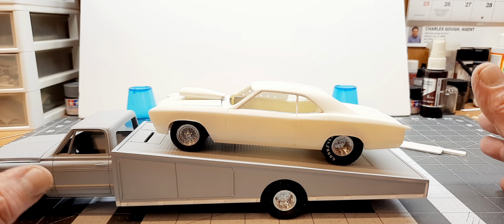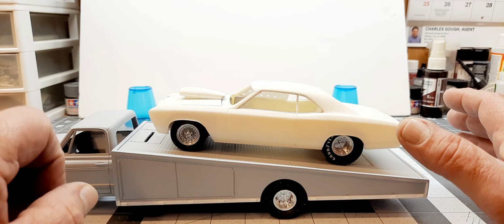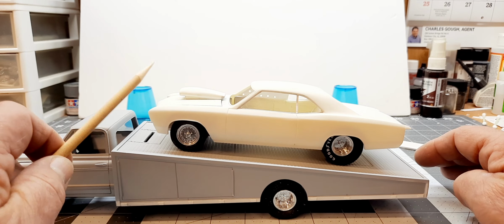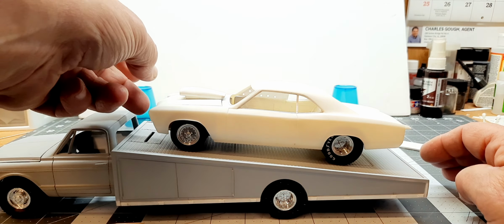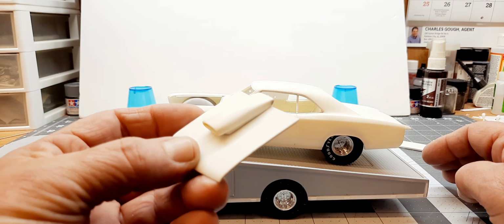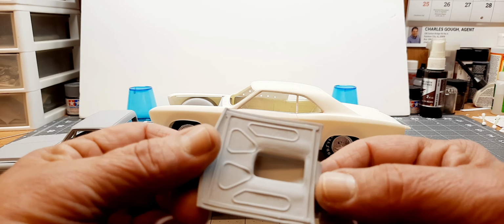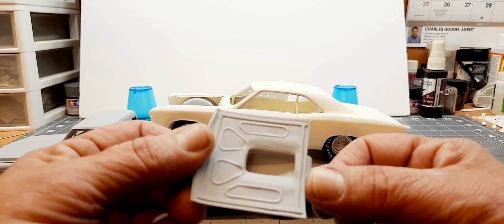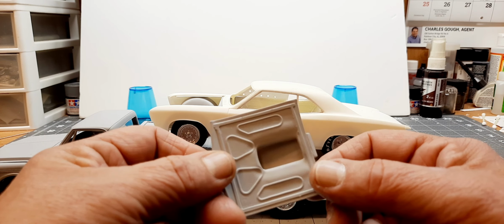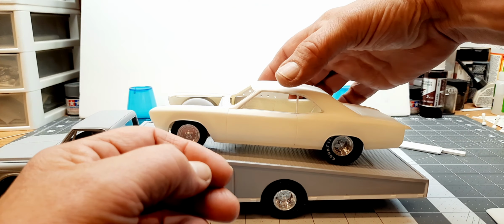I got some center lines out of my parts box. I've lowered the rear suspension a little bit, the front suspension a little bit. Dug through the parts box, found another hood scoop like the Nova came with. I modified the hood, got rid of the SS lumps. The hood scoop, I had to blend it in to get it all to look halfway decent. The underside of the hood is pretty much done. We'll be moving to primer and paint soon on this one.